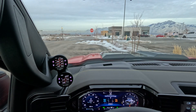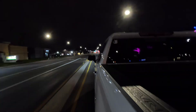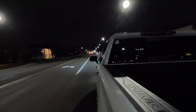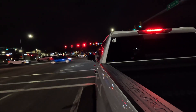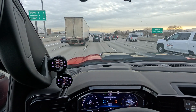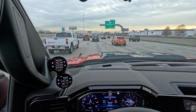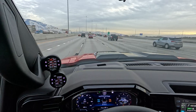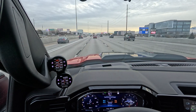If you don't have these gauges, there are a couple of ways to see that you are in regen. You don't have to do any of this — if you bought one of these trucks and you just want to enjoy it and drive it, by all means do it. But let me point out a couple of things that will help you extend the life of this, because these exhaust systems will not last forever. If you can do a complete regen in one full swoop, you're going to lessen the amount of ash left behind in the exhaust.